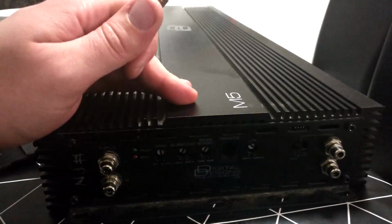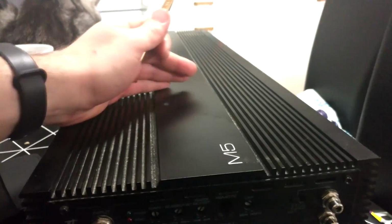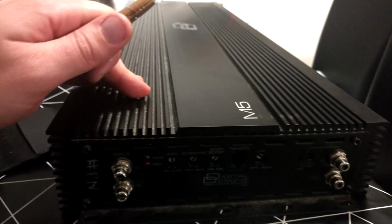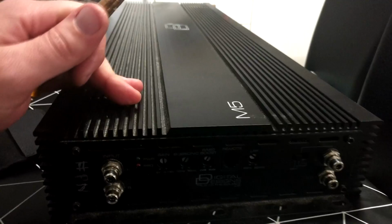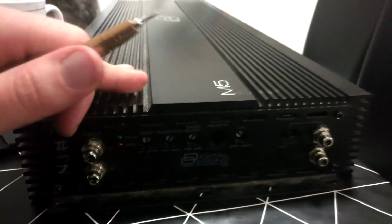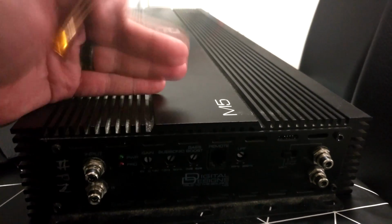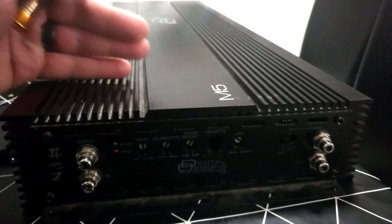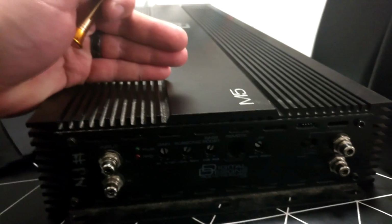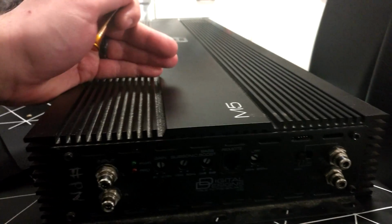So if you have, let's say, 1 ohm nominal load, with one subwoofer with dual voice coil of 2 ohms, and you set it to 1 ohm, and you are using a 30 Hz enclosure and then you play songs under 30 Hz, let's say 10 to 15 Hz, the actual impedance on the amplifier might go under the 1 ohm load. Sometimes, not always. Usually using ported enclosures, it will stay at least twice the resistance of the subwoofer.